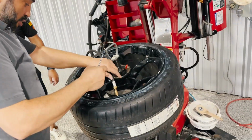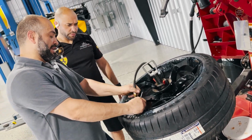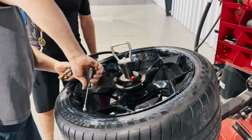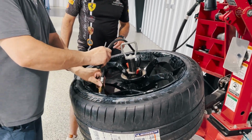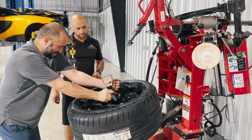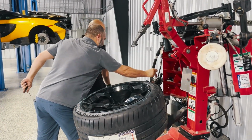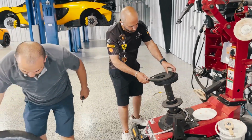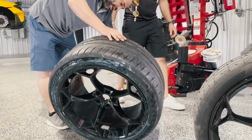You don't put more than 48 psi, just enough air to be in it. That's something that's safe. Put it in. Put about 35, that's 40. There. Okay. Then you release this, quick release. You push in and out. Put that in there like this. You need to organize it. Now, this is out. Now, before it goes to the balancer, you remove all the old weight.